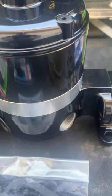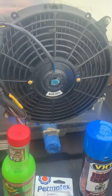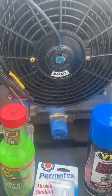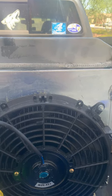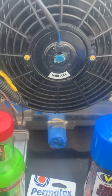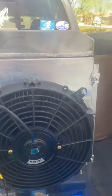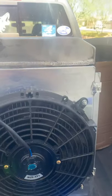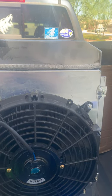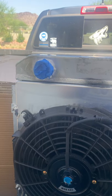On my 68, the lower radiator hose is on the passenger side. The problem is that on those 68 Mustangs the other outlet for the radiator was up at the top. Coolant just goes in, comes straight down, and comes out the bottom — I'm not using about 70 percent of my radiator because flow takes the path of least resistance. So I had a friend who's a very good aluminum welder remove the outlet at the top and move it over to the driver's side.